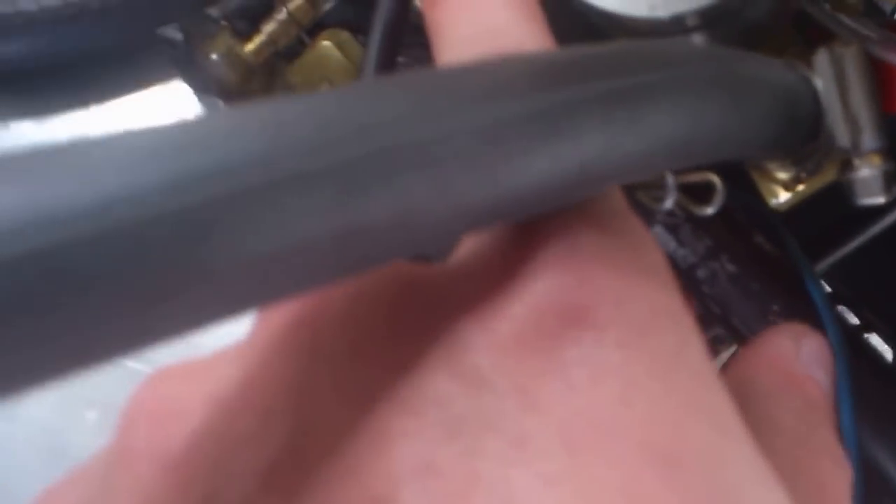The fuel pump goes through a fuel filter and back to the fuel pressure regulator, which regulates how much fuel the engine gets. I'm running about 2 psi fuel at idle. On boost, every 1 psi of boost adds 1 psi of fuel. There's a boost reference coming from the vacuum/boost line right here that regulates it. Internally the carbs can stay the same — you don't need to change anything and it will just work.